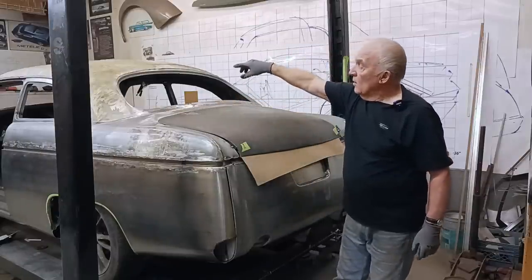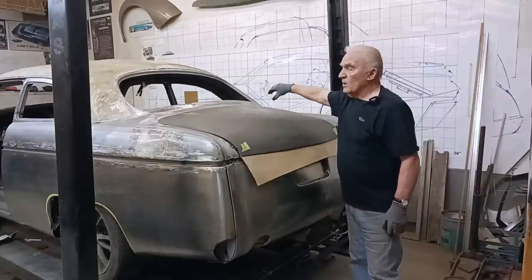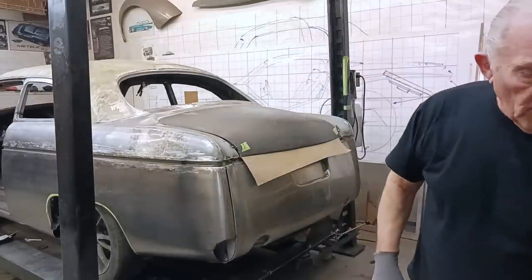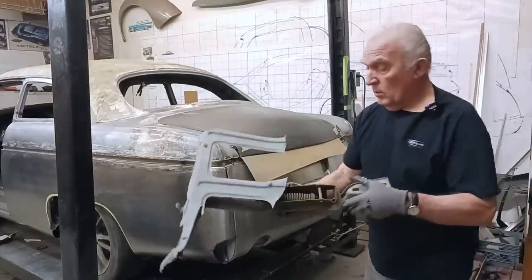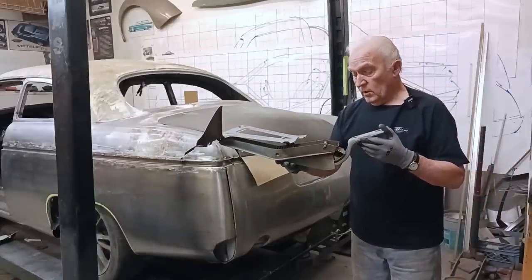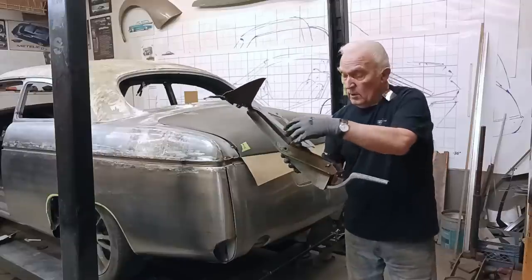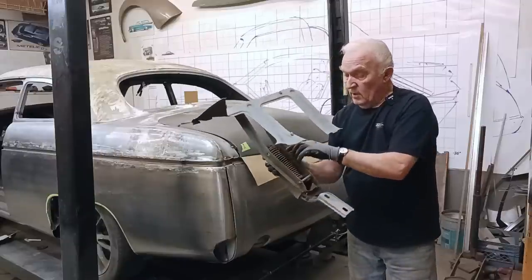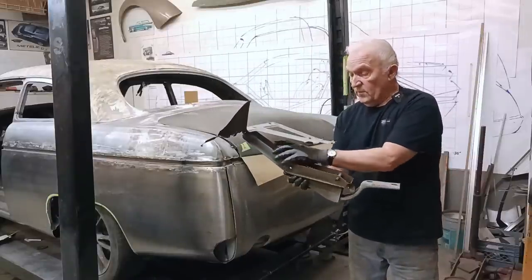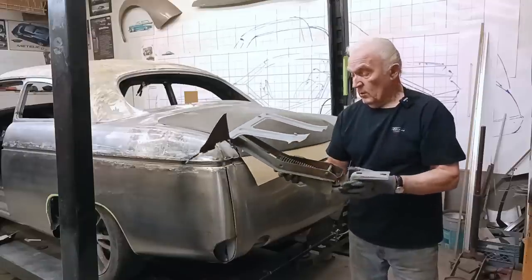This '51 has been morphed onto the Infinity, and the rear deck on the Infinity is far shorter than the original '51. This is the assembly they had to open the trunk lid — this was the rear deck up to here. You can see the conglomeration underneath: they have a compression spring that pushed the trunk open, so they needed space for that and bracing because there's quite a bit of tension on it. That's why all this ugly framework was there — you didn't see it underneath.